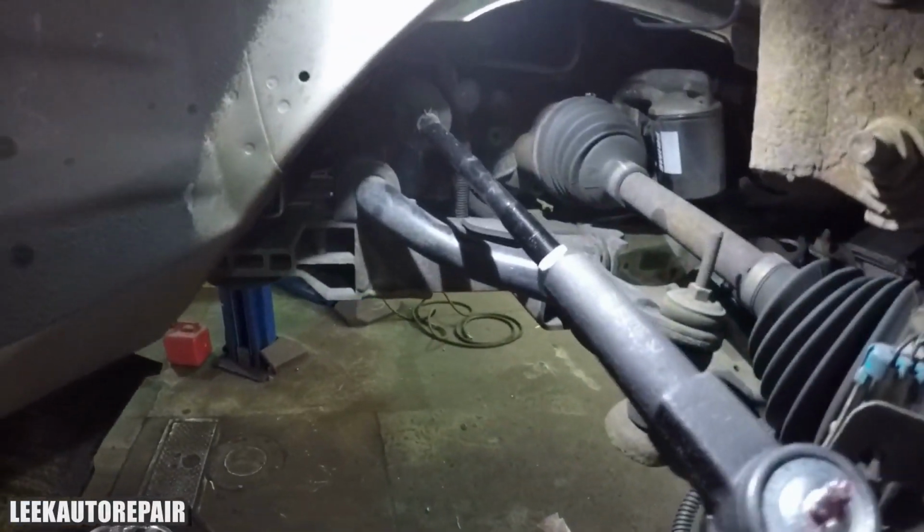So anyway, when you use this term, reputable shop, whatever, you can find something similar that gives good prices. The dealership, when I was at the Chevy dealership, and a Nissan dealership, they charge like $80 to $100 for an alignment, which is pretty fair because you get a four-wheel alignment, which means they adjust the rear of the car and the front, so they adjust all four wheels. Some cars you just do a toe-in in the front because you can't adjust the rear, it isn't adjustable on certain cars, so it's like half and half. But either way, go get an alignment.